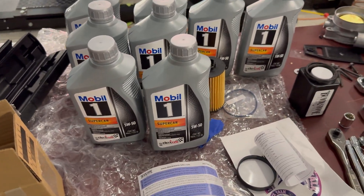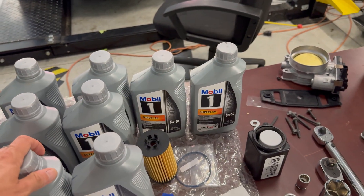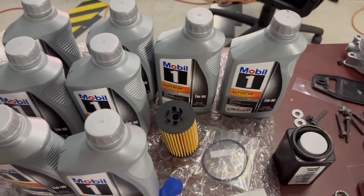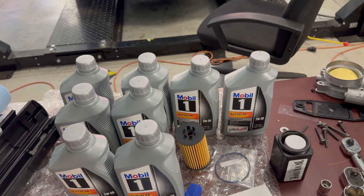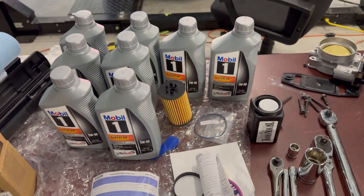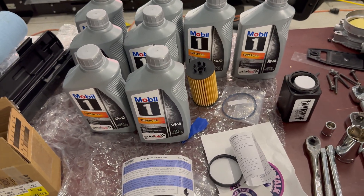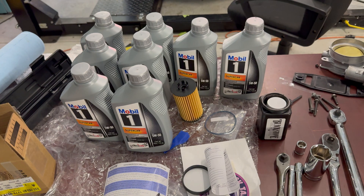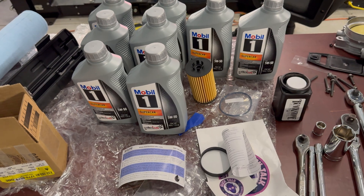Here's what you need. We've got eight quarts of Mobil 1 Supercar oil, 5W50. You can shop around — I got this for about $10 a quart, so about $80 in oil. I've got extra oil just in case. Then your paper filter that comes from GM — it comes with an O-ring. There is also a plastic quarter-turn plug, a secondary plug I also ordered. There are two drain plugs on this LT6, and the second one being plastic is at risk of stripping or breaking, so it's nice to have a spare. It's not required and not part of the service bulletin, but it's good to have.